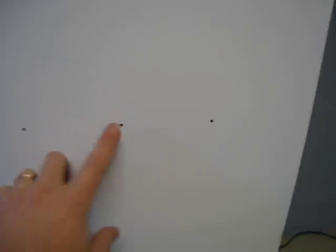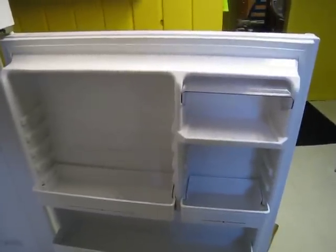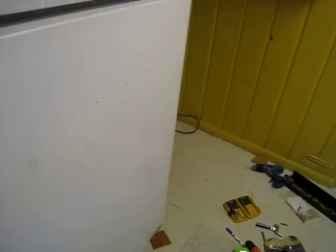So forgot to do a video, but what I'm doing here is I'm doing 4 holes for my 4 taps. And from my past fridge, I had them 4 inches apart, so they cover 0, 4, 8, 12. That's how I did it. And the drip tray I have fits under there. And the reason they're a little bit to the right instead of being centered with this fridge is because I've got this butter tray on the right. So I've measured it out, and they should all be able to just kind of come through this top part in here. And yeah, so now we gotta get the hole saw going.